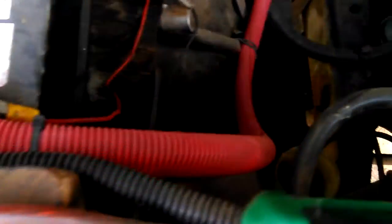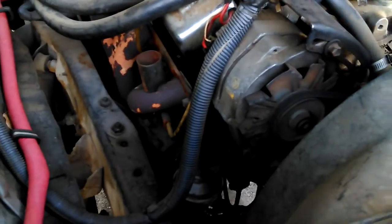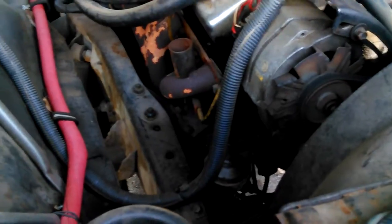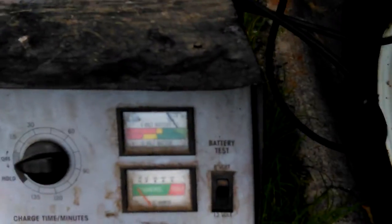See my big battery cables? I've got covers on them, but those are double-aught battery cables. Since I keep the timing really high on this thing to make it run the best it can, as soon as it winds up, it doesn't want to turn over.